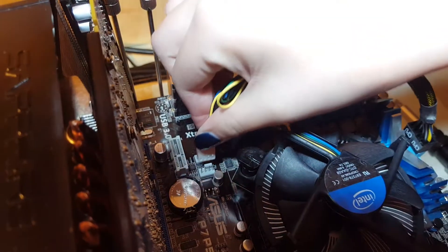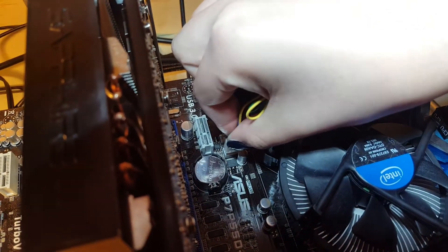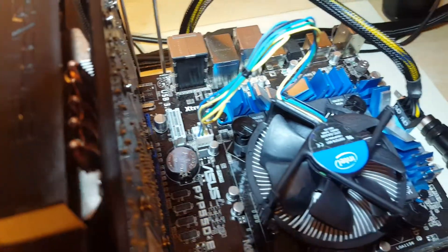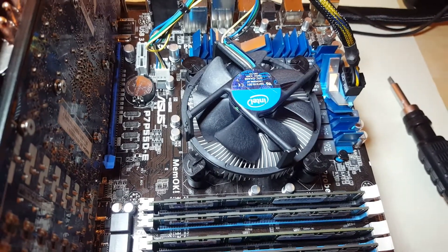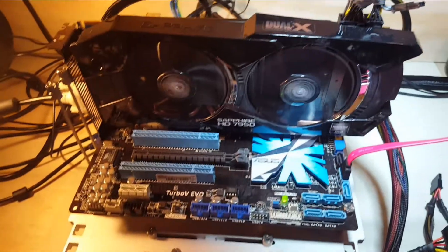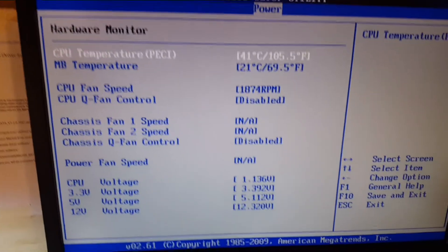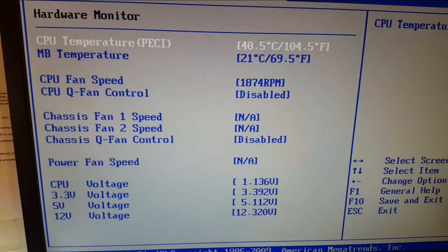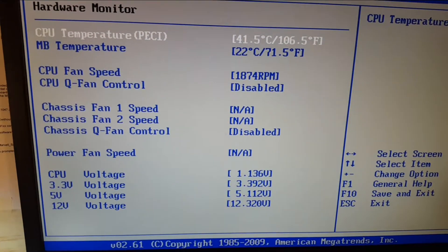Push right down and that's it. Turn the test bench back on, power everything back up, and we'll recheck our thermals. If you're ever in doubt about whether the pins went into the motherboard, you can lift up the end of the test bench and look underneath to confirm all the pins are protruding through. Now checking temps in the BIOS hardware monitor — we're going anywhere from 40 to 41°C and staying there.